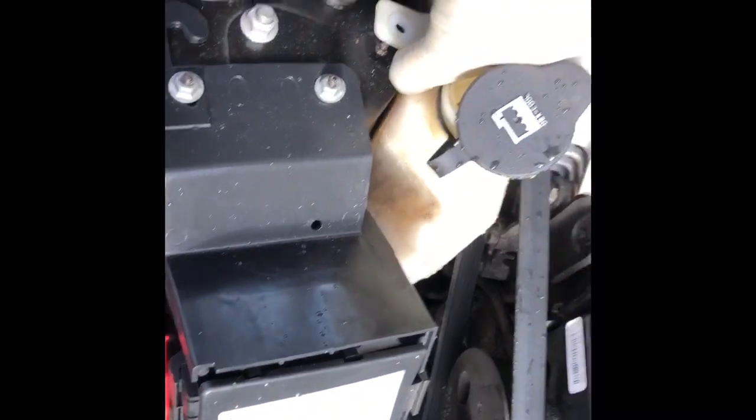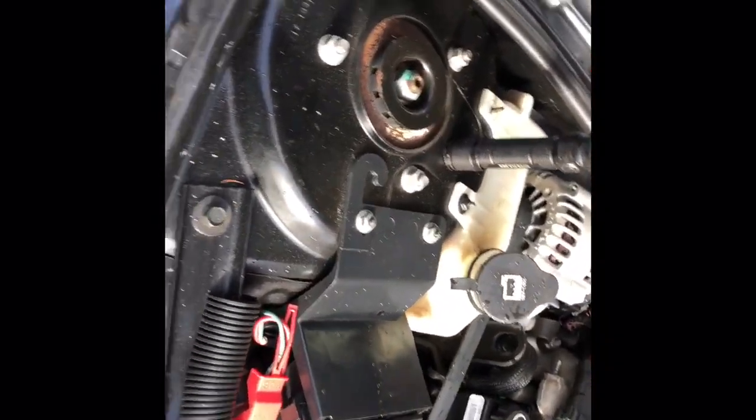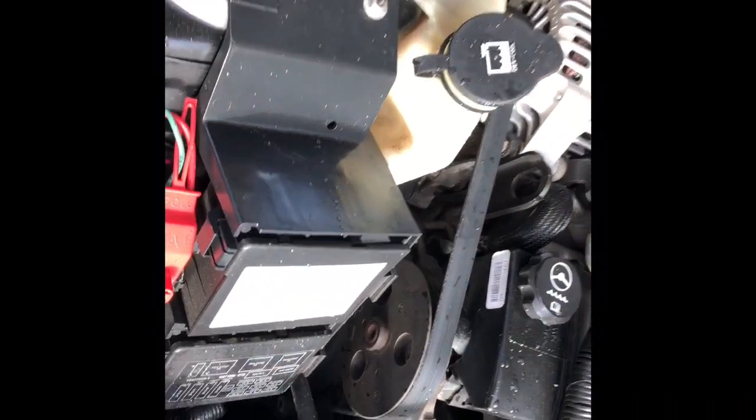You are not replacing it for this job. So you want to make sure you see that hook there. That hook is actually missing, but it's supposed to have a rubber grommet there. You push it in like this, and it seats onto that grommet so it doesn't get near the drive belt. But he doesn't have one, so we just want to make sure we bolt it down. Screws on, or should I say bolt heads? There's the other one in my pocket somewhere. Put that on.